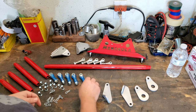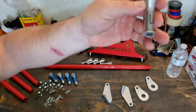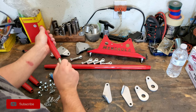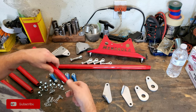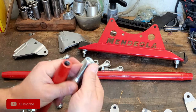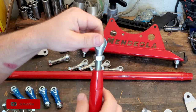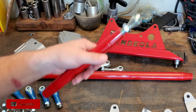The way it's designed is pretty cool. You've got left-hand and right-hand threads. You're going to put one left-hand and one right-hand thread on each one of these struts. I just need to find which one's which. So there's the right-hand one. Need to add a lock nut on here or else you're just wasting time. You'll run these down, and then once you get them kind of in position, you'll take the bar and move it out or in to tighten up the strut.